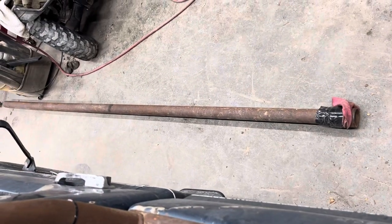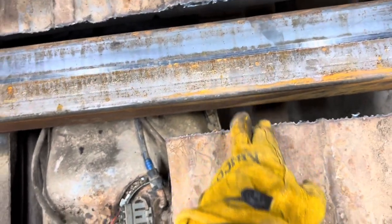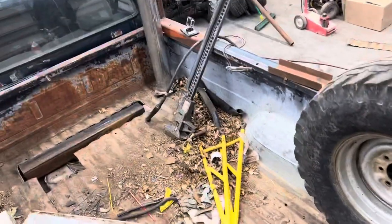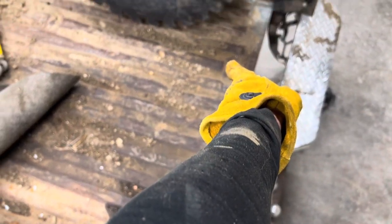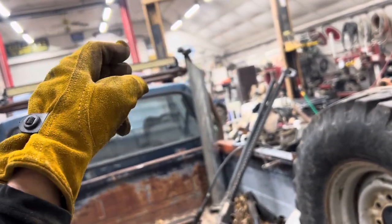That big pipe there will be the boom, and that little pipe right there is going to slide inside of it. The big pipe is going to slide into the hole on this, and there will be a pin in the middle of it. It's going to run back all the way up. And there will be two supporting pipes here and here, bolted through the frame with a skid, and there will be a piece right up in the middle of it that holds that pipe